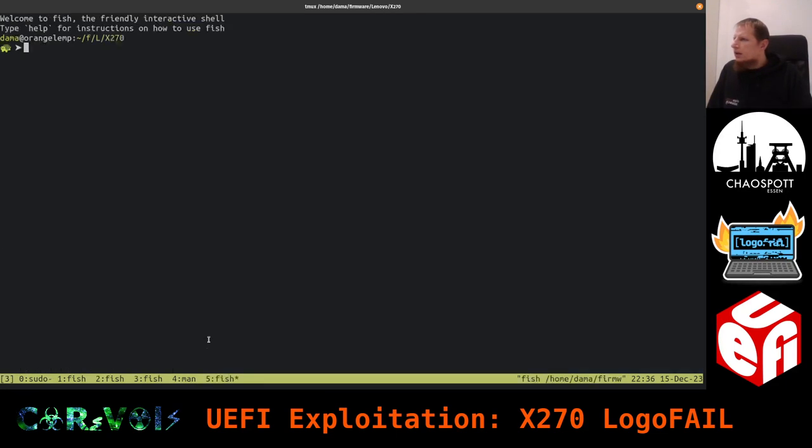Alrighty, so we are going to look at the /dev/sda file here, and that file is actually a disk. We're going to give a block size. The block size is 512, let's actually go with 1024. The output file, well, no, hang on. No dash here, just bs, without a dash. Now we give a count, so the count would be one. So we are going to dump 1 kilobyte, the first kilobyte of that drive. The output file would be USB a.bin, right?